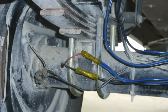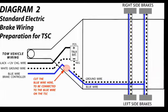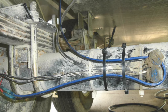Locate where the brake wires go through the axles to the right side brakes and cut the wires, leaving enough wire length to be able to connect the bonded pair wires. Do the same thing to each axle, connecting the bonded pair wires to the wires going through the axles. The electric brake wires do not have a polarity, but make sure that the bonded pair remain color matched blue and black. The left side brakes are still connected to the original brake wires going up near the TSC where the blue brake signal wire was cut earlier and connected to the blue wire on the TSC. If the original brake wires are in good condition, you can use them to connect the purple wire from the TSC and a white ground wire from the negative terminal of the trailer battery. If the original brake wires are not in good shape, use the bonded pair wires to connect the purple and ground wires to the left side brakes like was done for the right side brakes.